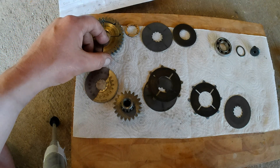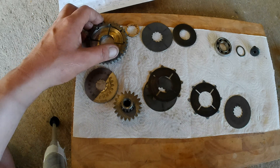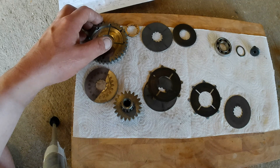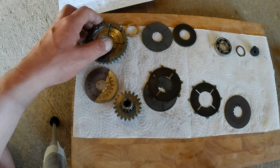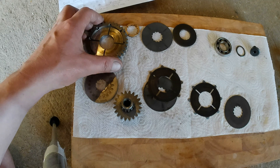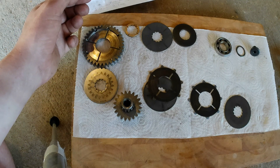To get this out of the G450X, I just took the engine out. I was going to try doing it with the engine still in the frame, but by the time I'd removed everything needed, I figured it was easier to just take out the engine mounts, remove the exhaust manifold, and unclip a couple of electrical connections. So I took the engine out and made the job a lot easier for myself.